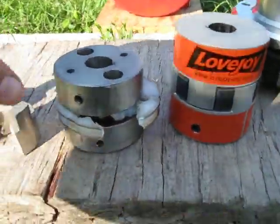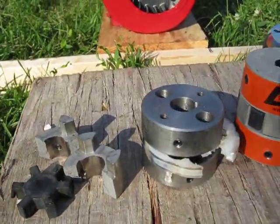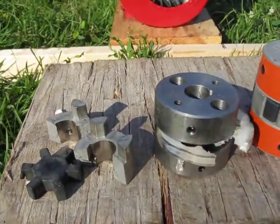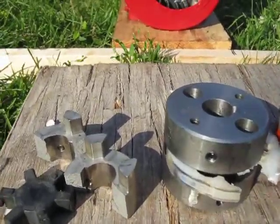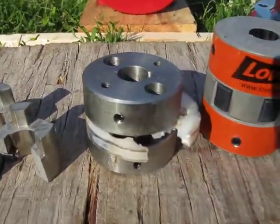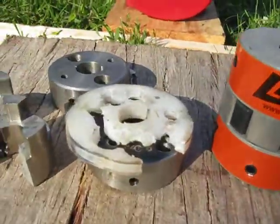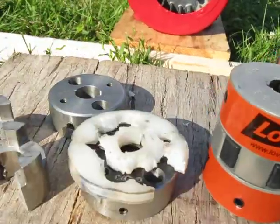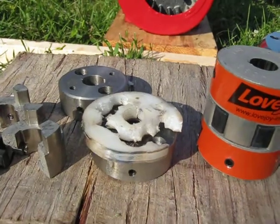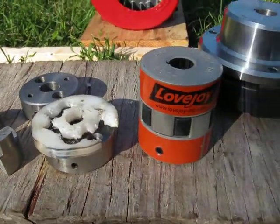I initially thought this was going to be a fairly simple project to get going, this Frankenbriggs 4. But it wasn't. I ran into coupling problems immediately and wasn't even sure if my starter was going to turn it over. Before Lovejoy got involved, I decided to make my own couplings using steel — basically hockey pucks — with plastic in between, countersunk bolted from each direction. I ran that on the two-cylinder, and as you can see, it got tore up due to misalignment.